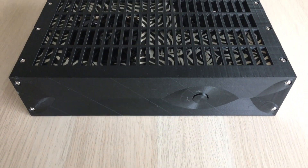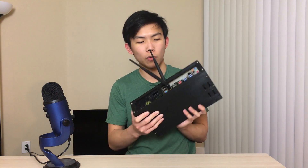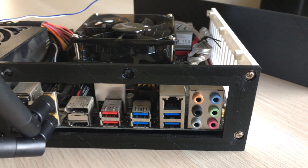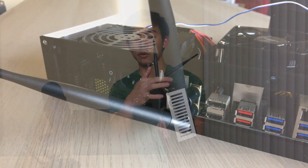The tape is purely for airflow management, not aesthetics. Without it covering the unnecessary vents around the fans and PSU intake, hot air coming off the cooler would get sucked back into the CPU cooler intake, which increases temps a lot. The tape blocks that hot air passage so the fan only draws cold air into the CPU cooler, and hot air exits out the sides and back. That's also why I didn't fit an IO panel, even though I measured the cutout to the exact size of a standard PC IO panel.